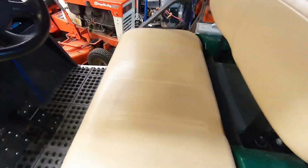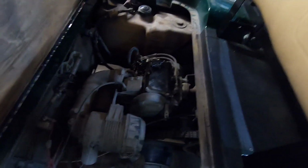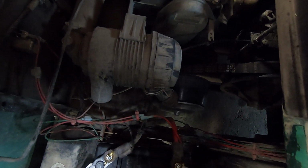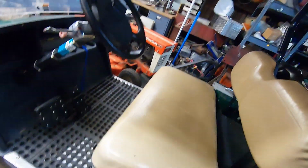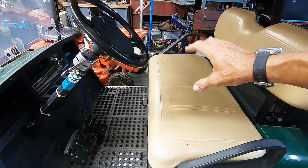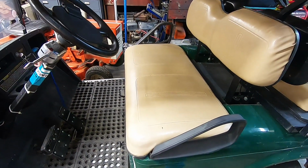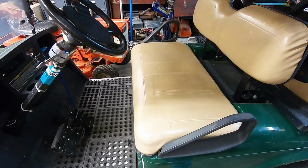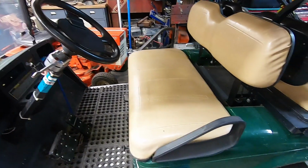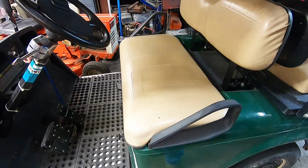It is. Okay. Take a listen. This was run quite low on oil, and now we have a noise that it shouldn't be making. Hear that tappity tappity tap tap? It's only running on one cylinder. I'm hoping it's just a rocker arm that has come off, or it's dropped a push rod, something to that effect. But we shall see. Doesn't sound like something swinging around in there like a broken connecting rod, but it could very well be.